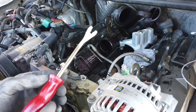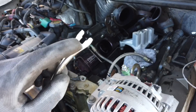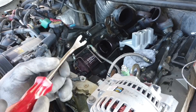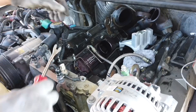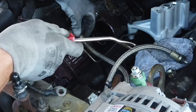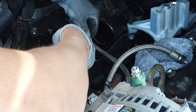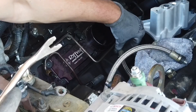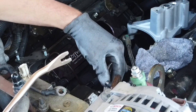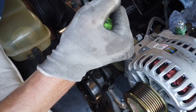To pop off the oil lines I'm using a small pry tool — I have a few different ones, this is the bigger one with a larger opening. It fits into the groove on the plastic fitting. I just have to wiggle and pry a little and it should pop off. I also ordered a proper tool from Riff Raff and I did buy two new lines to replace, they just haven't arrived yet. There we go — a little more oil coming out, not a big deal. Let's see how tight this bolt is inside.